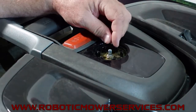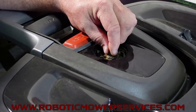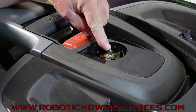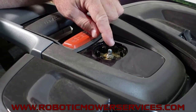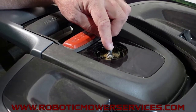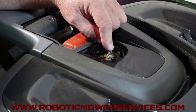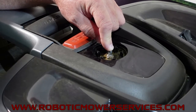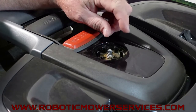The other reason the button sticks is the switch itself. When you push down on it, you should hear a double-pop sound — it bottoms out and then pops again when it comes back up. Listen closely to that action.